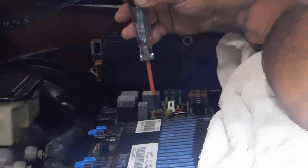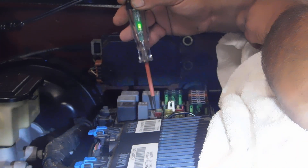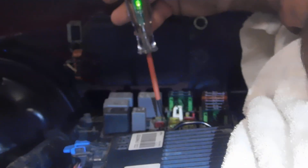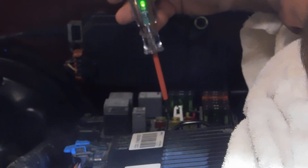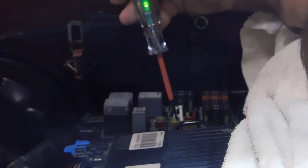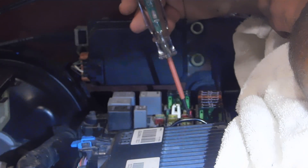Now there's three left up here in the front, and this is what's interesting. Watch this — green. It doesn't mean your fuse is no good unless both sides don't light up green. So this one here, both sides are green — that fuse has got current going through it, or a completed circuit in other words. This other one here also has green on both sides. Once again, green on both sides.